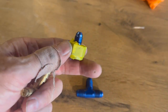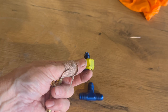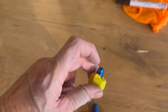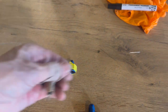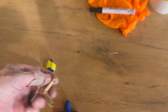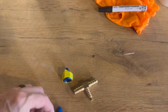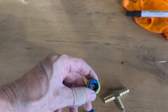The second bit - I've put some tape around it so I don't lose it - is a reducer to go from AN6 to AN4. What I did was drill from behind and tap it quarter-28, but I just didn't run the drill all the way through so it'll still seat properly with AN4. Then that T-piece - I just happened to have two - can screw in from behind, and because the diameter fits neatly inside AN6 there's no problem. That covers me for the jetted T-piece. It was actually quite easy in the end, just took a little bit of head-scratching.